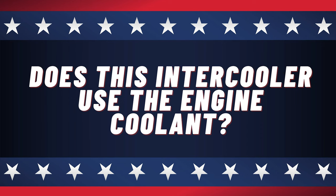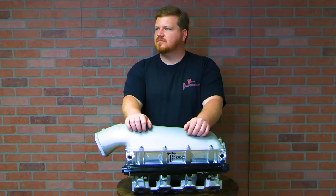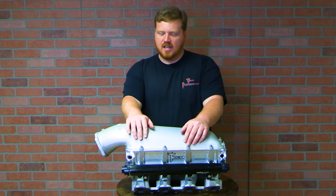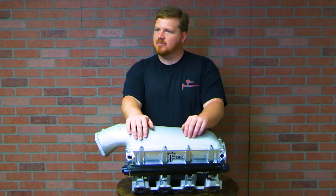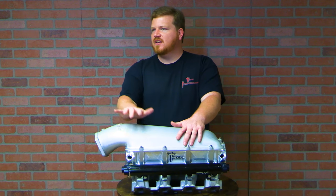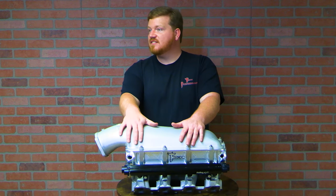Some questions come in with the assumption that you're running engine coolant through this intercooler — how would you respond to that? I wouldn't do it, because even if you're pulling water off the cold side of the radiator, it's still hot. The intent is to run a water box somewhere in the car. If you do a lot of street driving and want a heat exchanger setup, that's an option, but I certainly wouldn't run it in with the radiator that cools the engine — I would have a separate radiator to cool just this.